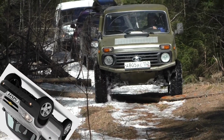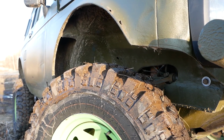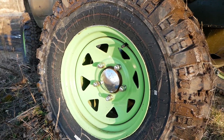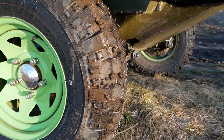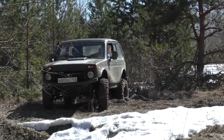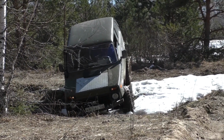It was borrowed from Chevrolet Lada Niva VAZ 2123. Forward Safari 500 tires were bought for about 80 bucks each. Nothing really special, just not expensive usable tires with 31 inches diameter and 10.5 inches width. The rims are off-road, 8J15. Steering is stock, except one thing: to operate such heavy and big wheels, a reinforced steering pendulum with the double row bearing was installed.